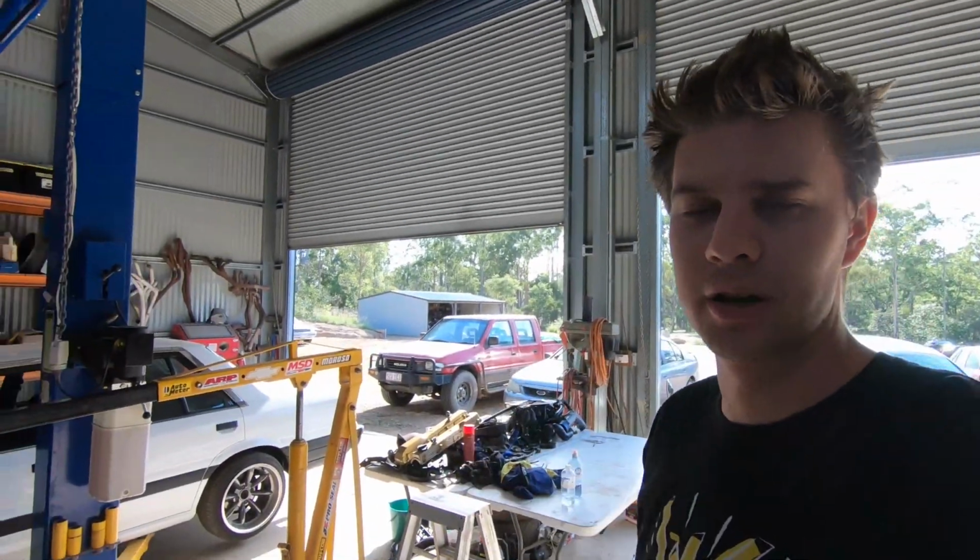And then later on we might chuck the Deadly Rodeo up on the dyno just to see what it's doing. I wouldn't mind just having a look, but well, we don't know. Like, we played with that pump a little bit. We turned up the fuel a bit just to get it going a bit better, and it has been going a bit better. But ever since, it's obviously been sucking air somewhere in the diesel system, which makes it a real bitch to start. So it's not loving starting on cold starts and stuff now, because it must be sucking air somewhere in the diesel system.